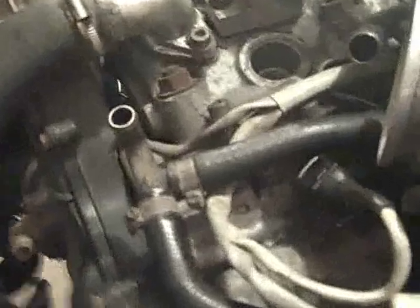Alright, so prior to setting the flywheel lock in place, we have to set the engine at top dead center on cylinder 1. In order to do that, we're going to be viewing the flywheel inspection port located by the speed and position reference sensors, which are in the back of the motor. And you can see that the window is somewhat obscured.